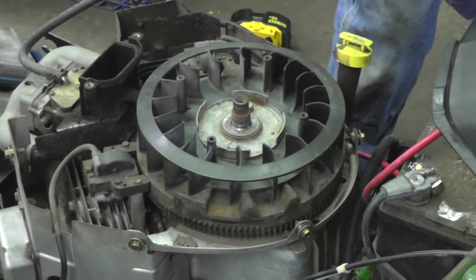But in case you don't, you can get out Mr. Testlight. Remember Mr. Testlight? Hi, Mr. Testlight. Hi, Taryl. You gonna do a test with me? I sure am, Mr. Testlight. Are you gonna clamp me to the negative side of the battery? I sure am. So clamp him to the negative side of the battery. And then I'm gonna touch it to here, because this is the one that's going to the fuel solenoid. So when I turn the key on, the light lights up. So I know that's the fuel solenoid one. So you may have to perform some tests if you need to. Okay, I'm done with you, Mr. Testlight. Okay, Tom, put me back in the drawer.